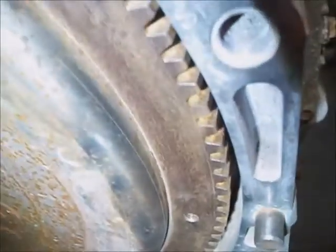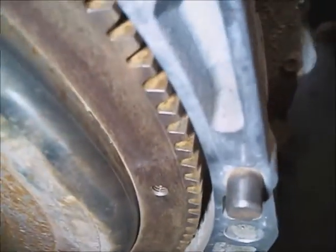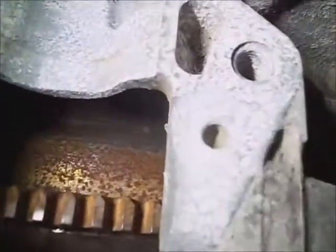I took a tap and went around all the torque converter holes and cleaned the rust out of most of it. There's a hole that's got just a couple threads in the back. I'm taking a drill brush and going around the face of the bell housing and around the dowel pins — it's just going to look better that way. I'm going around the torque converter with a wire drill brush too. It'll be a better surface for the bolts to hold on to, and on the starter face this will look better than the gristle. It's taking a little while, but I'm getting it done.